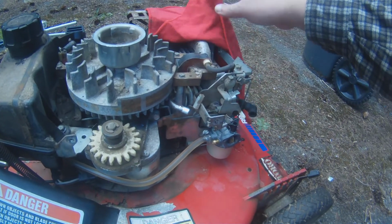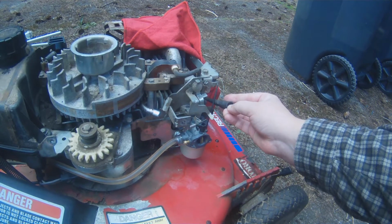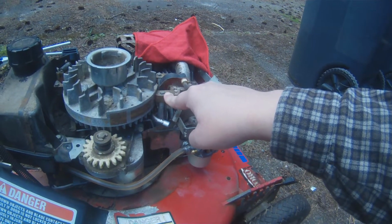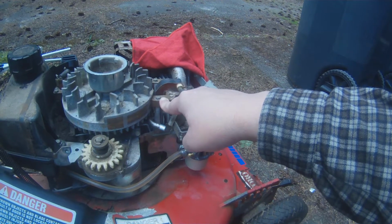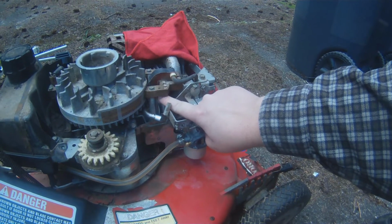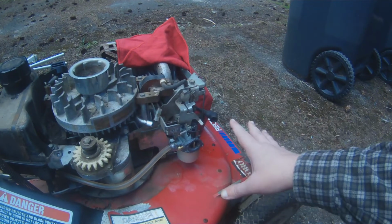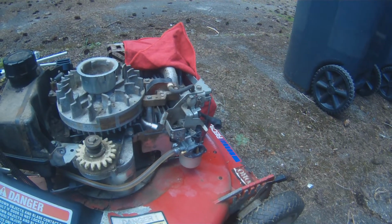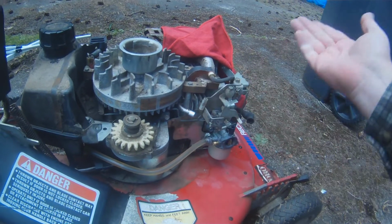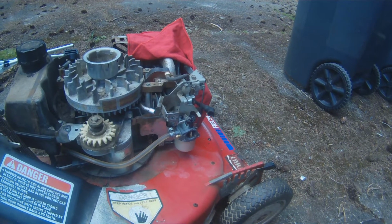Okay, so I tested the spark plug wire, the base of the core of the coil, and the kill tab, and they're all within spec, both when the engine's cold and when it has just died. The readings are exactly the same. I ran it without the kill wire, and it runs again for about 2 minutes and dies.